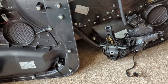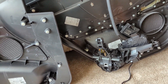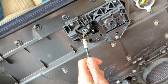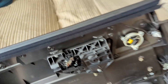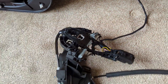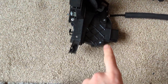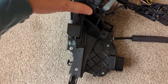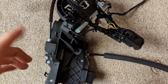Each of the doors has got slightly different mechanisms on them, which makes it difficult to know which one's which. I've attached the door handle on the inside of each door card just so I can keep track. Each door is fitted in this way to take the clip out. There are three main plastic components for each of the two door handles: the actuator piece, a large piece of plastic that comes up as a bracket to hold things, and then the door handle mechanism — the internal part that connects to the bit on the outside of the car.